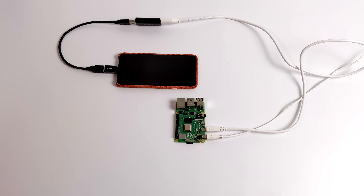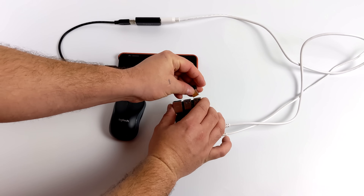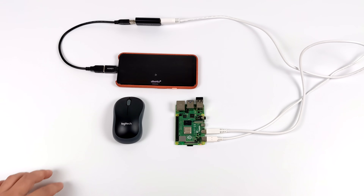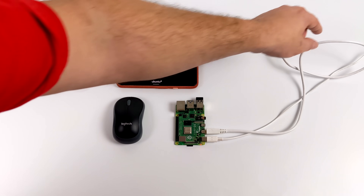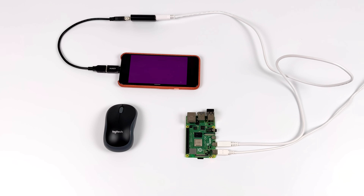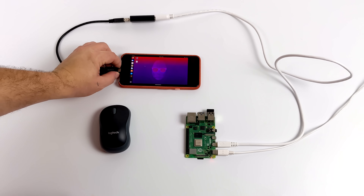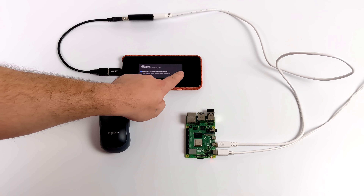When it's hooked up this way, we're not going to be able to access the touchscreen on our Android device to control the Raspberry Pi. You will still need a keyboard and mouse hooked up to control the operating system on your Pi. The way it's hooked up right now, we're just basically sending HDMI video into the phone over that USB capture card. We're just plugged right in from the Pi to that USB adapter right into the phone. And this is hot-swappable, so if your Raspberry Pi was already running, you can just plug it right in. If you don't allow access all the time, it'll always prompt you to allow access to that USB device — I just choose allow all the time, so every time I plug it in it'll come right up.